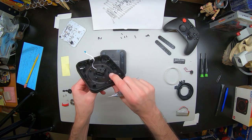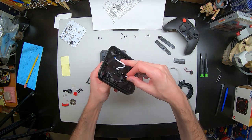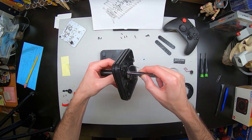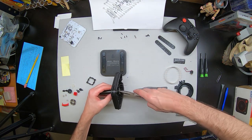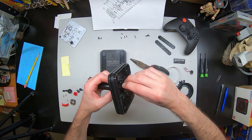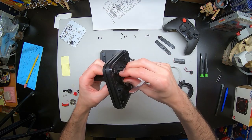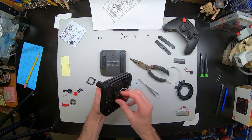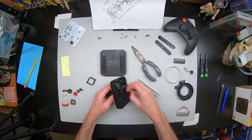This part clips over the inner part that is held in with the pin, with two little clips on the left and right there. And then that's just securely popped in — more or less just a part to hold it together and to keep the ribbon cable off to the side. Now I put that in there and I'm trying to get the pin in, but having that part in is actually preventing me from seeing and guiding the pin into the hole on the other side. So I realized I should take this cap piece off so I can actually see what I'm doing. It's the first time I did it — live and learn, and that's why I'm making the video so you guys don't have to figure it out the hard way. I luckily didn't break anything from my disassembly and reassembly.